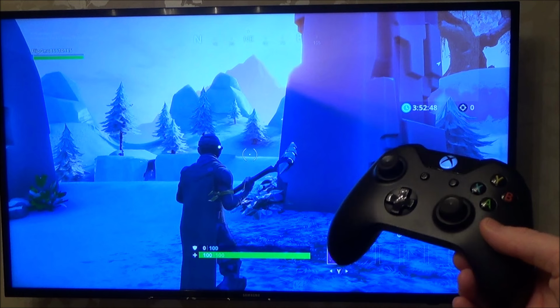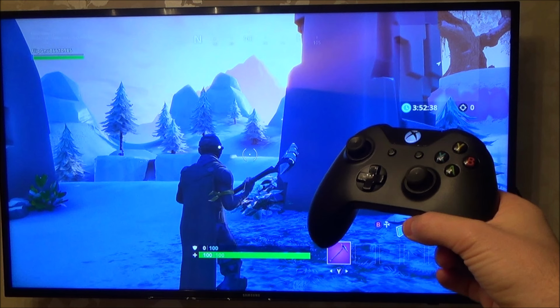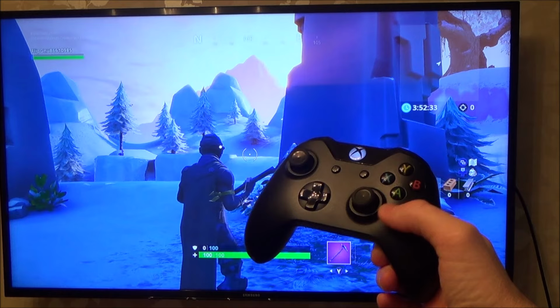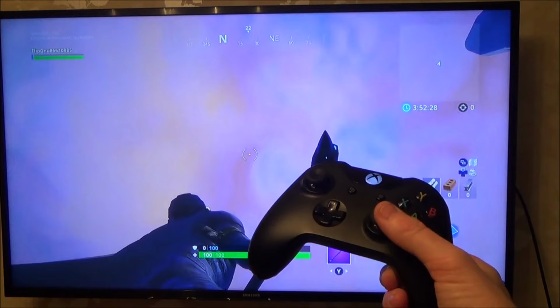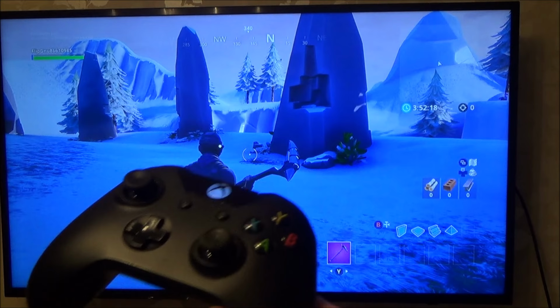In this instance, you've seen what I did in the end. Well, I replaced the analog stick, which was also faulty, but that's my own fault. If you were to buy a new one, that's not going to happen. But you did see that I just changed the actual X or Y axes part, and it is now working. So that might be an option, rather than unsoldering all 14 pins. If you're just having problems on one of the axes, then you might get away with just desoldering three pins and then soldering three pins, which might be useful if, for example, you're not very confident with soldering, or if you haven't got a very good soldering iron.